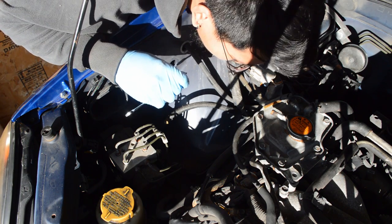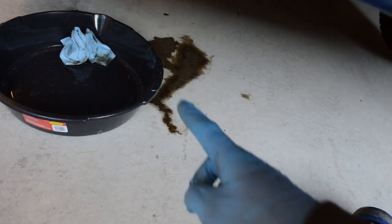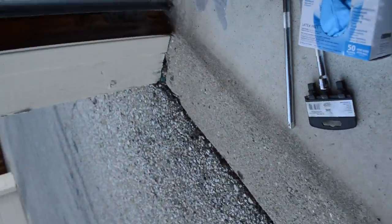Really scary right now that I did strip the bolt. So that's what happened there because I didn't have the pan in the right spot. But I wanted to show that I got a couple of these bolts down here. So that one there, and then that one there. Put them off to the side over there. Only those two. And then the jack will go like right here. Lift the engine up. Those are 14 mil bolts. And then there was the other bolt in there.